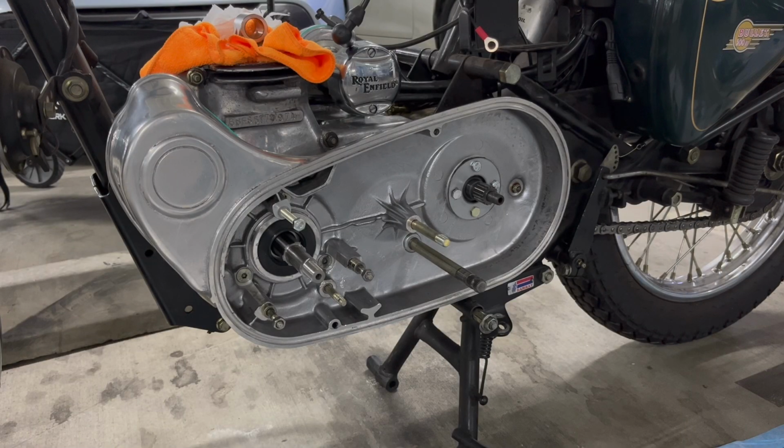All right, I'm going to put the rear hub of the clutch on first. It's just going to make it easier. And then the clutch basket just slips over it because it's a little bit more technical. It's got to go through the little splines of the transmission.